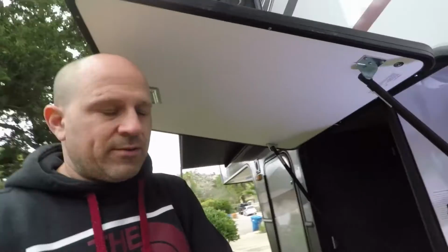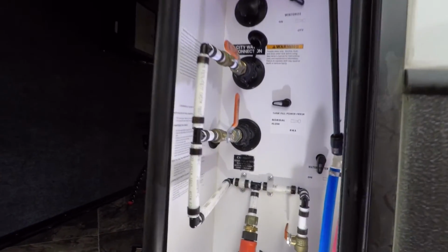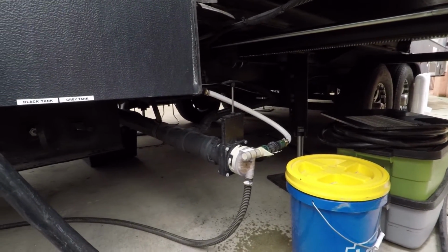Okay, I'm gonna turn off the black tank flush, and you can see how the one-way valve kicks in. Well, it didn't bleed that much, but you can see that nothing can come back out of there. It would just drop out at the one-way valve. So nice and clean, safe system. So now we're running the water macerator one more time. Macerator, did I say that right? Macerator. And we'll flush it again, and it'll be sweet.